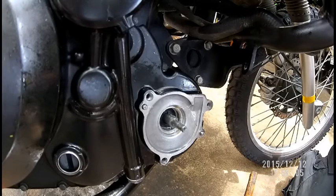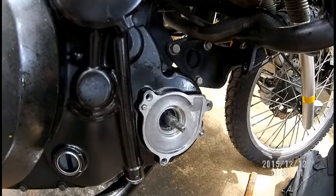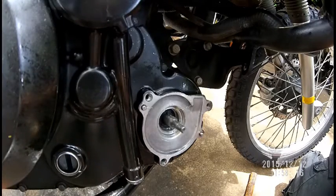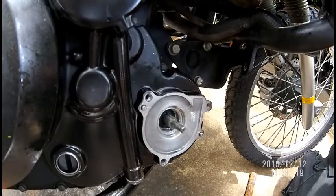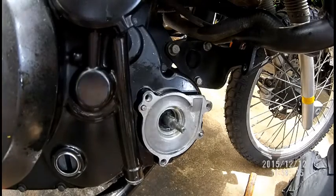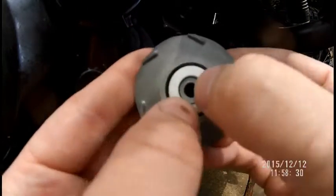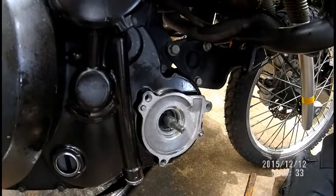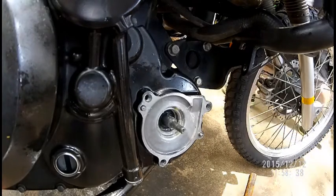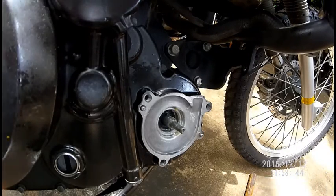Nobody look. This one you put into the impeller. So there's the impeller one. Coming out. And you just put it straight in, okay? Alright, so I've got this. Now, to damage this black facing surface, you've just got to touch it and it basically cracks, because it is so fragile, okay? I just call it carbon. Yeah, it looks like solid carbon. Graphite ring. Yeah, graphite, which would be very brittle. Yes, I'm not paying for it.